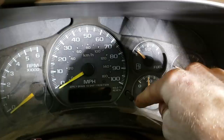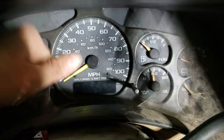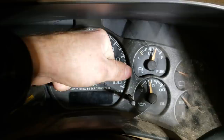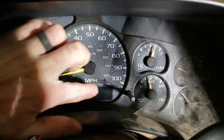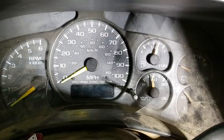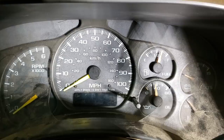So the entire lens here is cracked. You can see right here. And what happened was, it used to be that if I just kind of tapped on this, the gauges would start working again, but then it got to the point where I had to hit it harder and harder and harder. One time, I literally punched right through it, breaking the plexiglass. And now what I have to do is push right below here where the odometer reads. From what I know, there's a pin connector right here that essentially, over time, the solder on those pins basically gets heated and cooled, and doesn't make contact as well. So we're going to pull this out and see if I can figure out a fix, because it shouldn't be too bad, but...